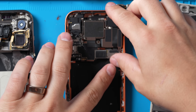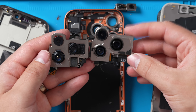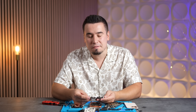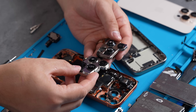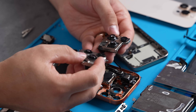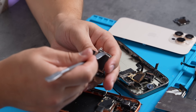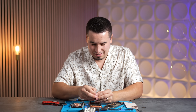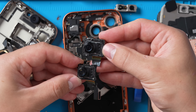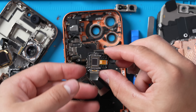Now let's take a look at the brand new 48-megapixel telephoto and all this camera goodness. Look how much bigger this area is for that telephoto — this is the new 4x optical 48-megapixel, with a much larger sensor, about 56% larger. The ultra-wide and the main cameras are pretty much exactly the same. With the previous telephoto you had three little open holes, but on the new telephoto it is closed. Let's pry it out and compare the modules side by side.